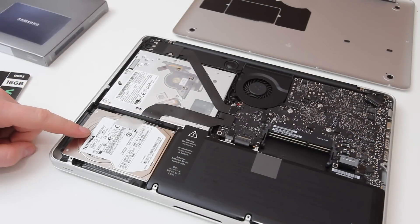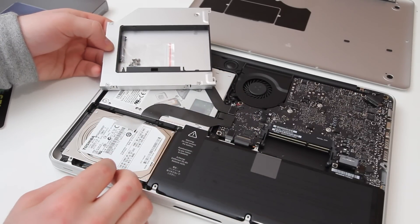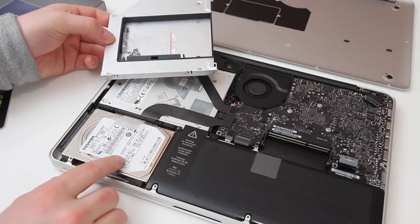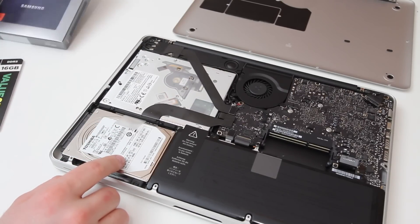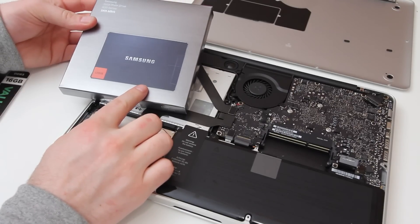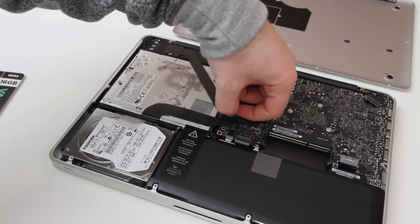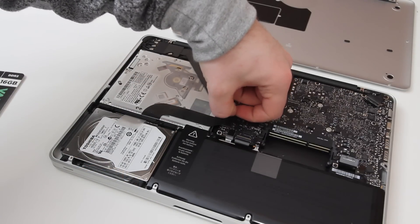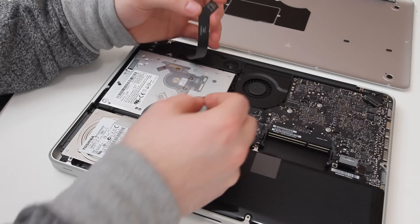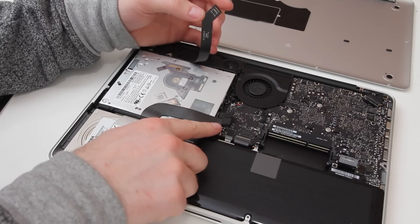In this particular upgrade, we'll be keeping the traditional hard drive and using an adapter like this. It fits into the optical drive bay and allows you to install a 2.5-inch drive, whether it's an SSD or another traditional hard drive, so that you can keep a bunch of storage while really upgrading your performance with an SSD like this Samsung 830. Things are a little more expensive in the SSD world, so getting your OS and applications onto an SSD can really improve performance — it's an amazing upgrade for the price. You can still keep your traditional hard drive for media and larger files.